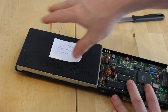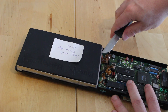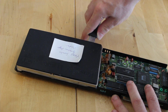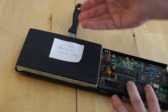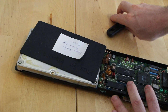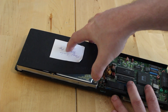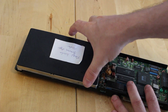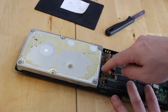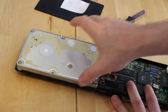The first thing I want to talk about is how to get this cover off so you can get into the internals of the drive. I use a very short knife — this would be very difficult with a long knife since you need to apply a lot of force. I just dig it in under the plastic material and cut. It takes ages to cut all the way around. You always want to take the knife away from your body because it will slip out and you'll cut anything in its path — so be extremely careful. If you try and lift the cover and peel it off, it will snap the plastic — absolutely will snap. When you get inside, there are screws that you have to take out and also a nut which has to be unscrewed before the cover will come off.